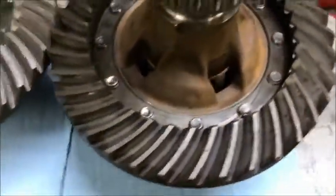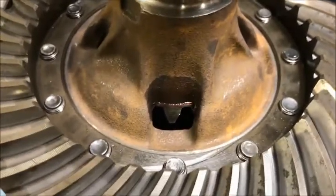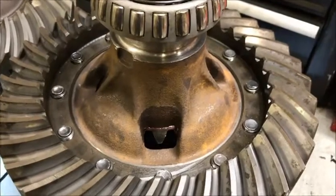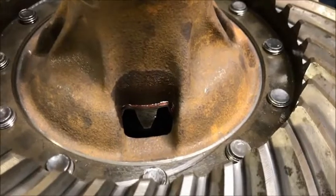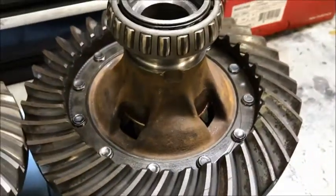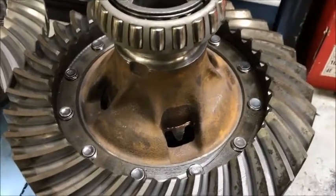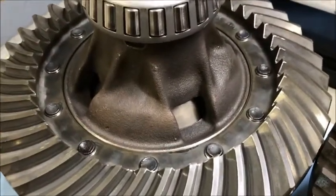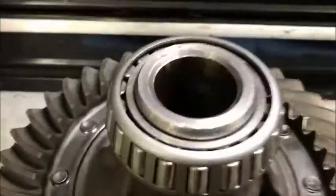Let's take a look at the top. This is a 514, which I took out of the donating axle and put on my original carrier. I decided to keep the carriers matched to the gears so that they would not have any wear pattern problems down the road, because I'm not making any more of these things. I'd hate to have one shell out just because the wear patterns are screwed up. And this is the one that matched the locker — I've moved my 71 ring gear over to it and put new bearings on there.